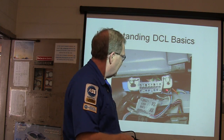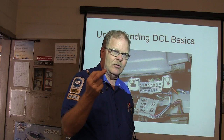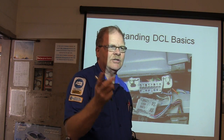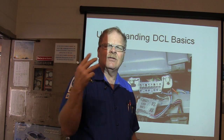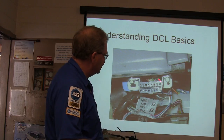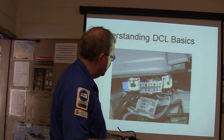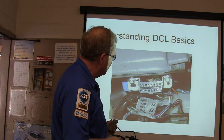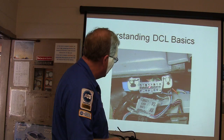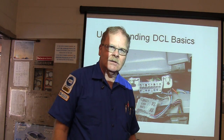Something else I want to tell you: you remember I told you there's two different modes. There's an OBD2 mode, an OBD2 enhanced mode, and then there's a generic mode in the engine controller. They even talk over different wires, and that sort of thing changes from one to the other. You've got a couple of wires here and one down there, but the long and the short of it is that one and these two are the constants. Both of these are supposed to be ground, and that one right there is supposed to be hot.